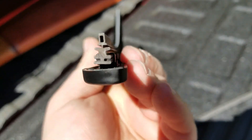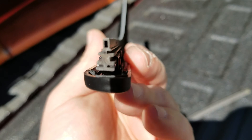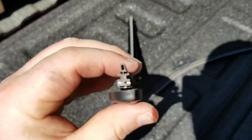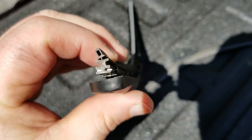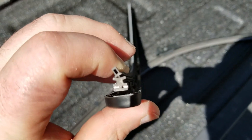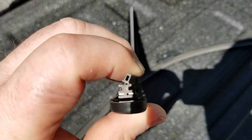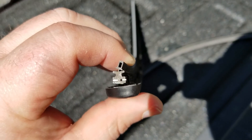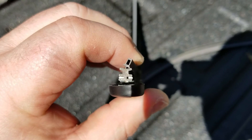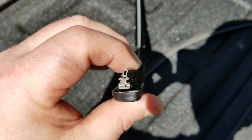One other thing you'll notice about these blades — I'll get a real good close-up — you can see the blade is not pointy, it's kind of a rectangle shape. What happens is whenever the wiper goes one way, it turns and puts the point on one side of the rectangle, and whenever the wiper goes the other direction, it turns and puts the point on the other side. So when I rotate it, it goes from one point to the other.